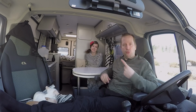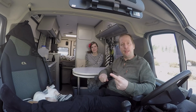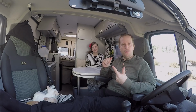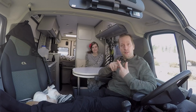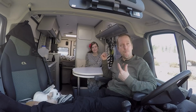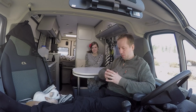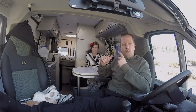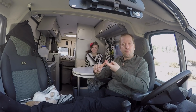When your batteries are full, you don't want to charge them. So there always has to be some kind of relay that stops the charging. Also, lithium dies if you charge it in below-freezing temperatures. Same thing: these batteries have a BMS with a low temperature cutoff. So basically there's this huge relay that cuts all the charging when either the battery is full or the temperature is too low. It's really simple.